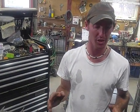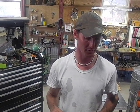So if you have a brand new motor, fresh rebuild, brand new head, fresh seats, that valve actually has to make its own seat because it's going to have grinding residue, little scratches, whatever on it. So, right out the gate, you set the overhead, you run the motor, run it 10,000 miles, and you check the overhead. Within 10,000, those valves are going to grind themselves up into that seat, and the clearance between the valve stem and the rocker is going to close.